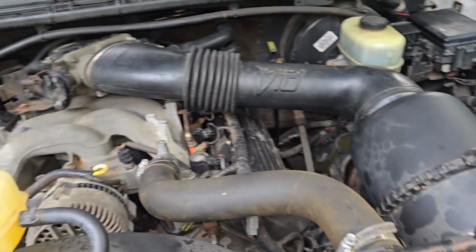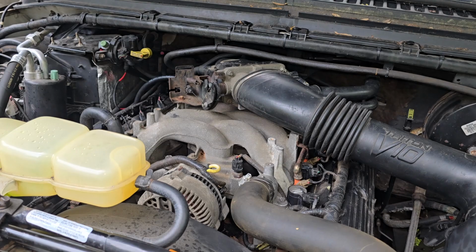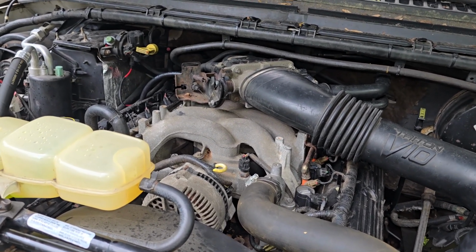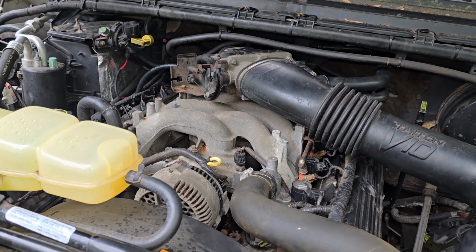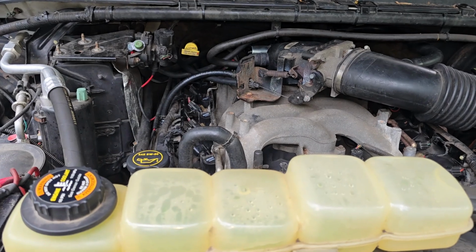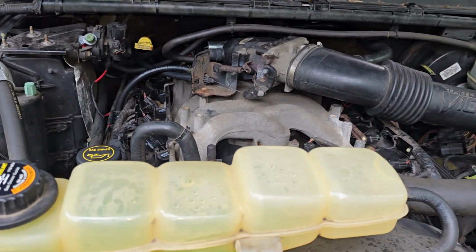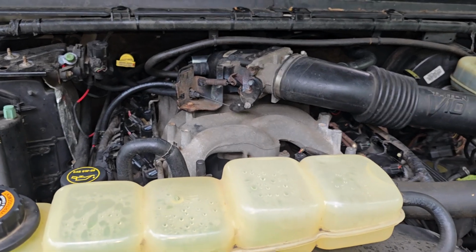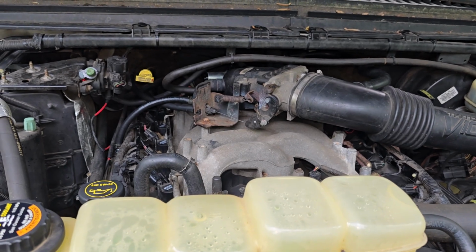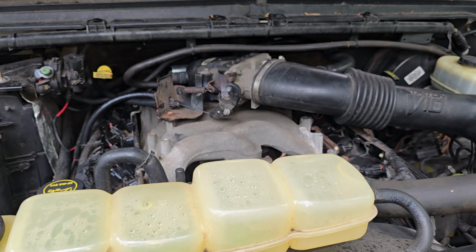same symptoms. When I check in FORScan, I can see all the MAF sensor data. I can see all the data. Everything looks fine. The only thing that stands out is the short-term fuel trim on bank 1 is running a little lean. So something's causing a lean condition on bank 1. Swapped out the O2 sensors because I couldn't find a vacuum leak, so figured I'd swap the O2 sensors. No change. It reads exactly the same. Like I said, I hate to say, but I've been part scanning a bit here because I'm running out of ideas.